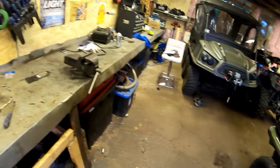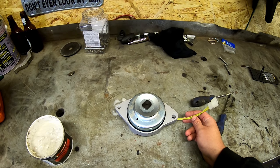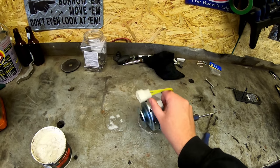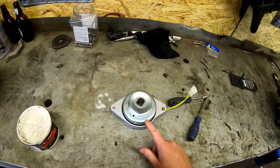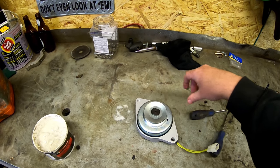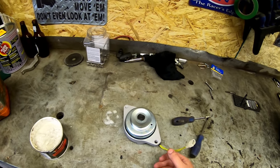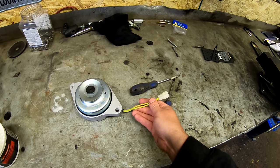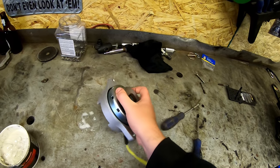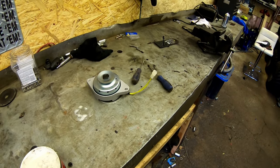Right now I'm trying to get some ideas for how to run my alternator. What you see here is a 20-amp John Deere alternator off a John Deere tractor. I didn't want a big automotive alternator like a Chevy — I wanted a nice compact one. This one is cool because it's a permanent magnet alternator. You can see it has a little vibration from the magnets inside — it cuts the electromagnetic field. It only has two wires, both pure AC voltage. If I can power it off the engine with a little pulley system, 20 amps is plenty — I'll have an extremely simple, reliable alternator.